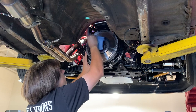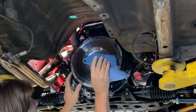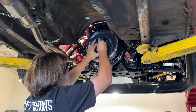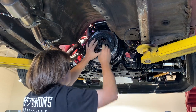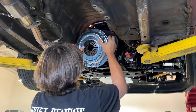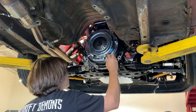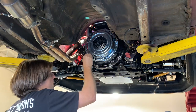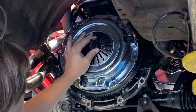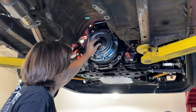The first step before we install the clutch is to use a little bit of acetone on a rag to clean the mating surface on the flywheel. Next we take the dry side of the rag and wipe off any additional residue. Now we install the clutch disc using the alignment tool. The pressure plate gets the same cleaning treatment before it gets installed. Before tightening any of the bolts I use the alignment tool to find the center line of the alignment on the clutch disc.